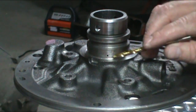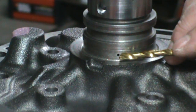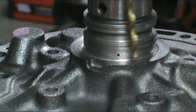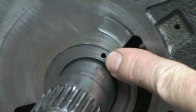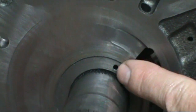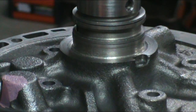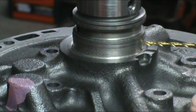Next thing we want to do — if you can see this very small feed hole right here — that hole is going to be opened up to 110 thou. That's going to give more fluid to this pump bushing here. And then the last thing we're going to do is, in the pump, if you can see this hole right here, we're going to take a quarter-inch drill bit and drill down, which intersects with this passage here, and open it up to a quarter of an inch. If you check your drill index, a 7/64ths drill bit is 110 thou. We want to drill that about 3/8ths of an inch in.